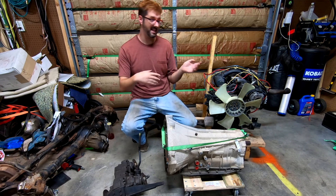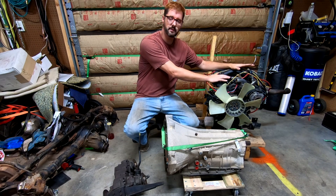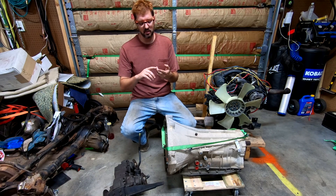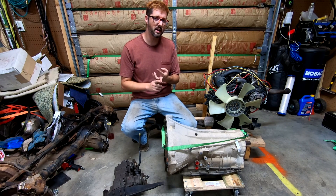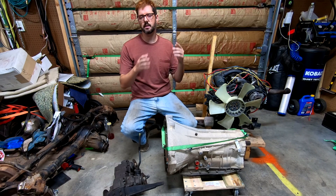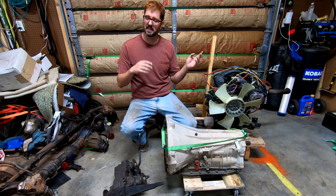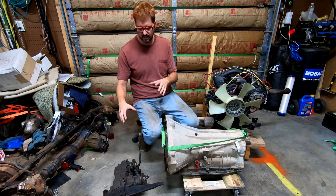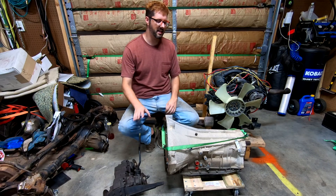This has changed since the last video where I announced what I was doing. Originally it was going to be this D-1503 Kubota 3-cylinder 1.5 turbo diesel mated to a Chevrolet Turbo 350 three-speed automatic adapted to a Toyota RF1A gear-driven transfer case. However, when I picked up the Suzuki Samurai to use the frame, axle, suspension, and steering as the base for my CJ2A, I didn't really realize how unique the Suzuki transfer cases were. I'll go into details about that in a minute.